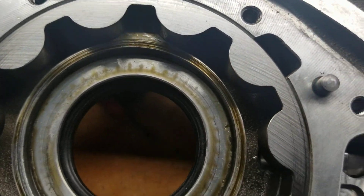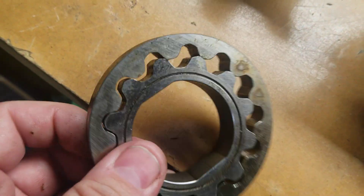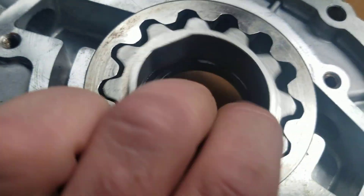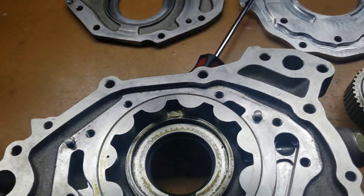There's a little bit of wear again on this one. The normal pumps have the inner and outer gear, and you get your flats — and like I said, you can see where there's usually some wear flats from contacting the crankshaft.